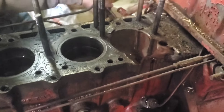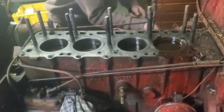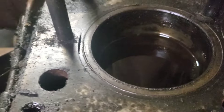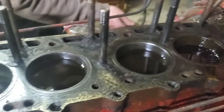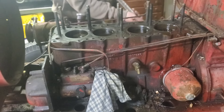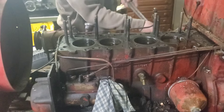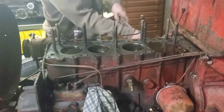Not easy, but the juice is rising. Nate go back — go the other way, you're overflowing it. There it goes — way better! It's free. I can see clean cylinder wall — it's free! Not completely free, but we've got room to travel. We can hitch it behind the Crop Master, pull it and it'll bust through that or break rings. At this point the pistons are wrecked. That section is about an inch of travel, probably. Cylinder one's about to overflow.